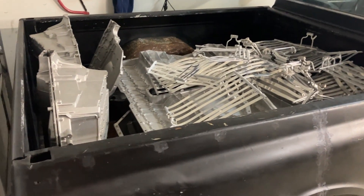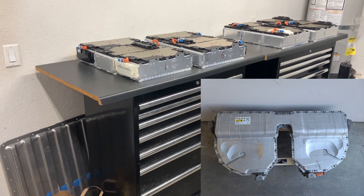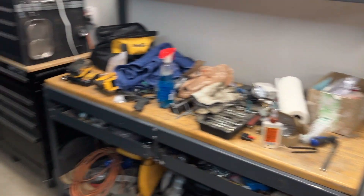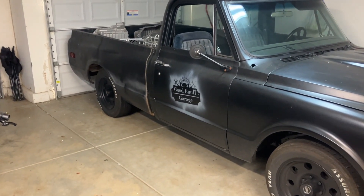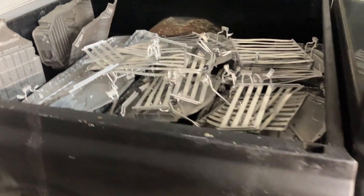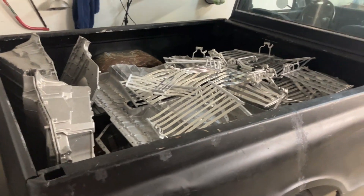So this is all aluminum — there's four of these battery boxes in here. In phase two we're going to be shoving more batteries into my truck, and here they are. These are two BMW battery packs, six modules on this side, six modules on the other. We have one like this in the truck right now — it's a nine kilowatt hour one. I'm going to take that one out and put two of the twelve kilowatt hour ones in instead, for a total of 24 kilowatt hours, about 80 miles of range. And here we just have all the guts and the boxes.